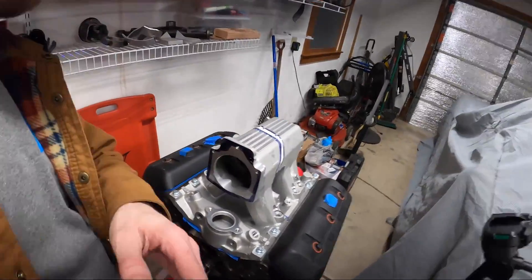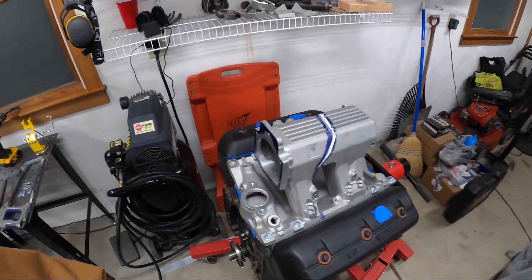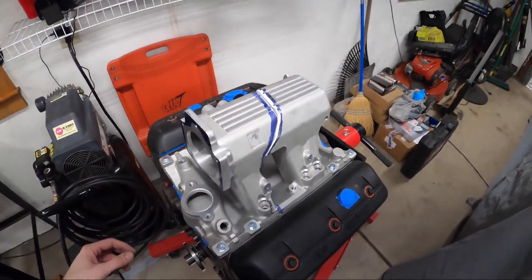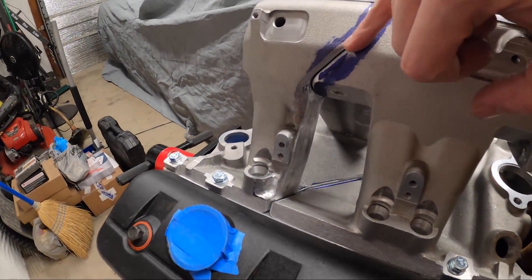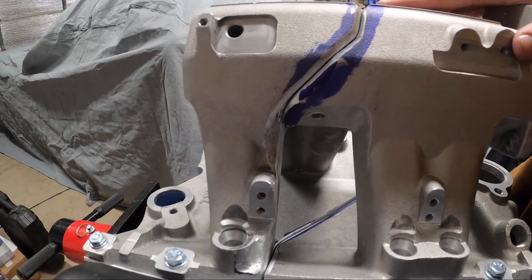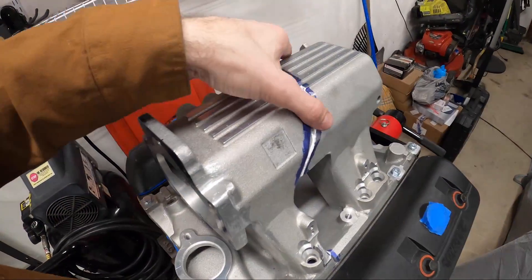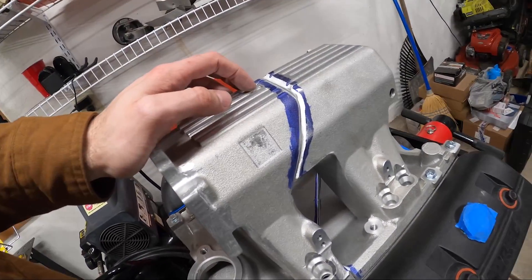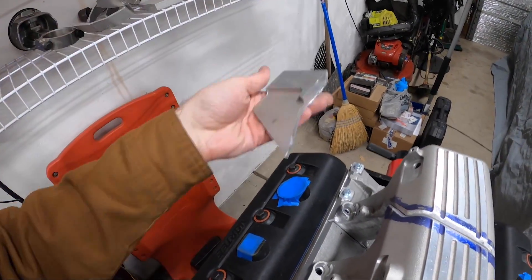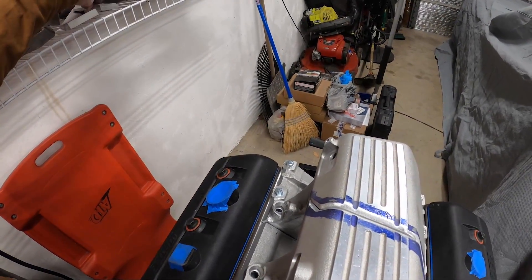Well, there we go — it looks like it's fitting pretty good. I might have to do just a minor amount of filing. I'm trying to get the tightest gap that I possibly can within reason between the two pieces of intake manifold. I went through and I don't think I can even fit a thirty-second of an inch once I have these kissed up to one another, so really no big gaps to fill. It is thick so I V-grooved it pretty decent. I might go a little more aggressive in a couple spots because most spots are a quarter inch thick, but down at the two flanges it's probably near a half inch thick, so I'll probably have to do multiple passes on those really thick sections.